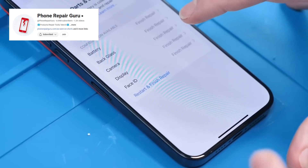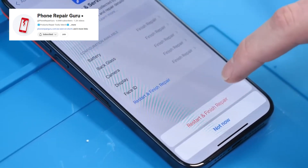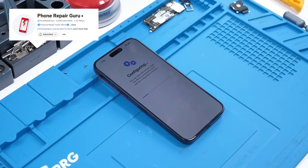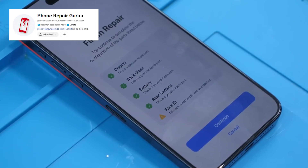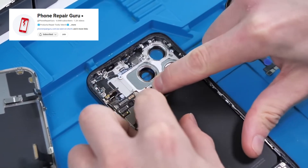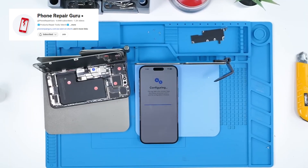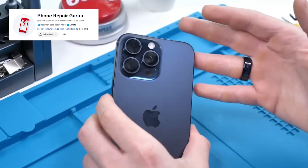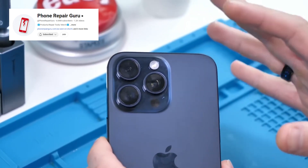After running through start and finish repair, the phone didn't brick — nothing happened. There were no locks, but the back camera couldn't be calibrated because of the same LiDAR issue. Most posts about Face ID calibration using a genuine part haven't been successful, though apparently some have. The original LiDAR scanner was reinstalled, and to my surprise, the camera calibrated. That confirms the LiDAR scanner is still completely serialized with no workaround or potential calibration process — there's always a catch with Apple.